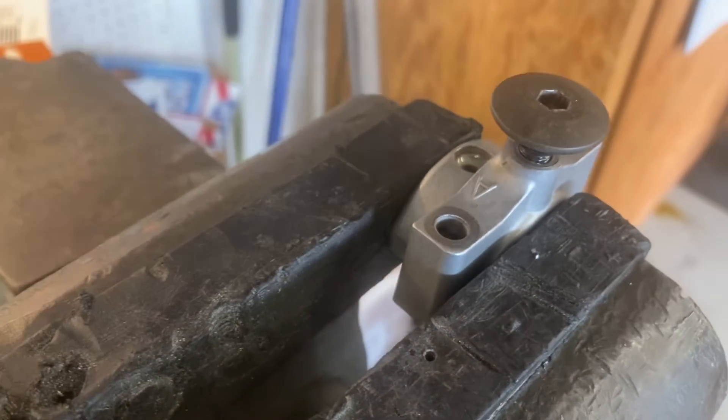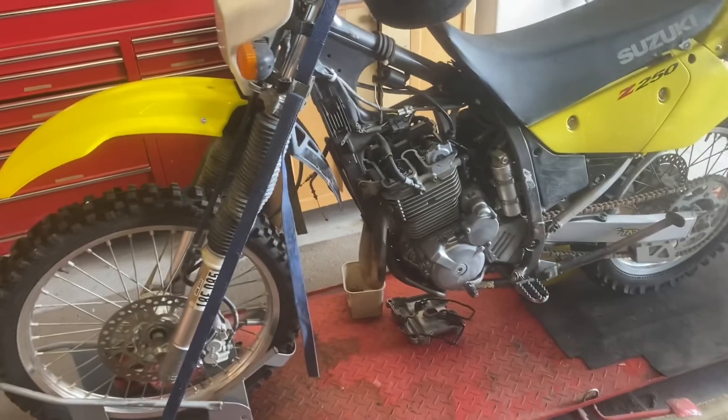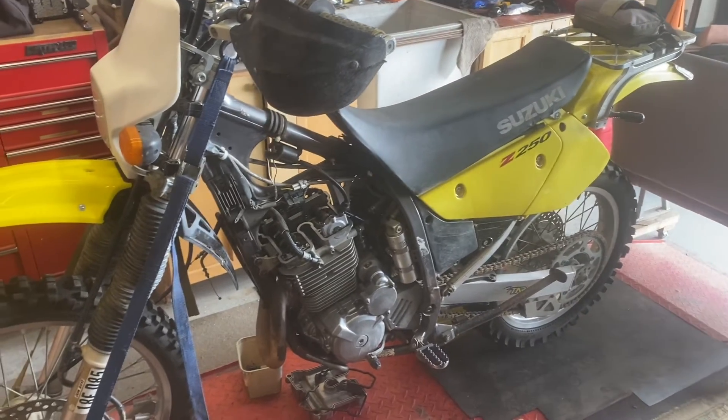Now all you got to do is reinstall this thing, put the cam cover back on, and hopefully no more leaks. Happy Suzuki — thread repair. It's not too difficult, but there are times when it can be stressful. If you've got to do that in a spark plug hole it's a little bit different procedure, but basically the same idea. If you need to buy a kit, most auto parts stores have them, unless you have a weird thread pitch like an M7 by 1.0 — then you're stuck buying it online and it's some weird crazy Chinese stuff.